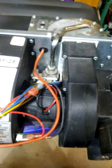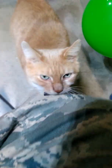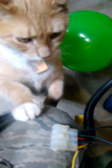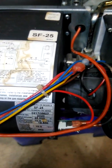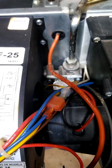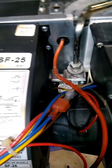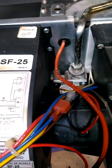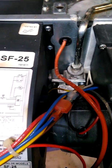I've shorted those two together so that it thinks that the thermostat has been activated. I took the nozzle out and cleaned it because I couldn't figure out how I was going to check this solenoid valve — the pressure in this system is only one PSI or less. So I had to use something at pretty low pressure that I could visually see flow through the nozzle and through the valve.